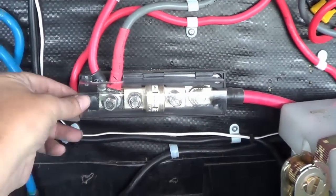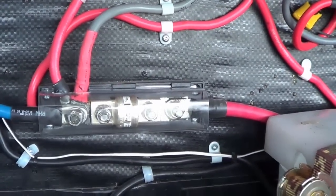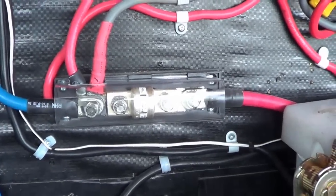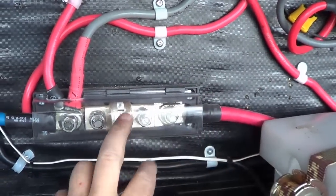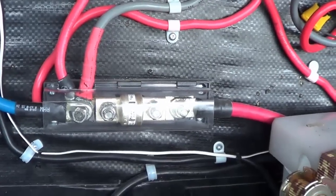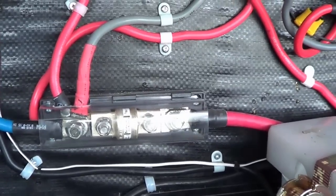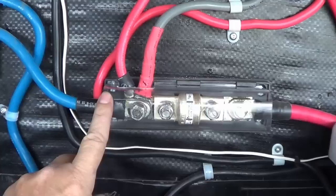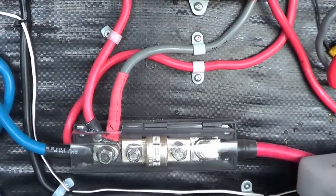This big monstrosity is the catastrophic fuse — it's the final fail-safe. I have fuses and breakers protecting different circuits throughout the rig, but this one sits right at the battery's positive line feed. It's a 250-amp fuse so if something really goes wrong before the rig could catch fire, that blows and saves it. On the other end of it are all the 12-volt loads: the feed to the inverter and the feed to the RV's 12-volt circuitry.